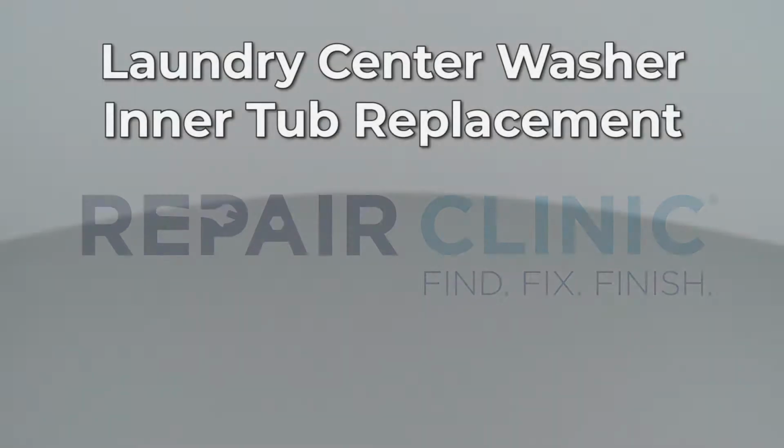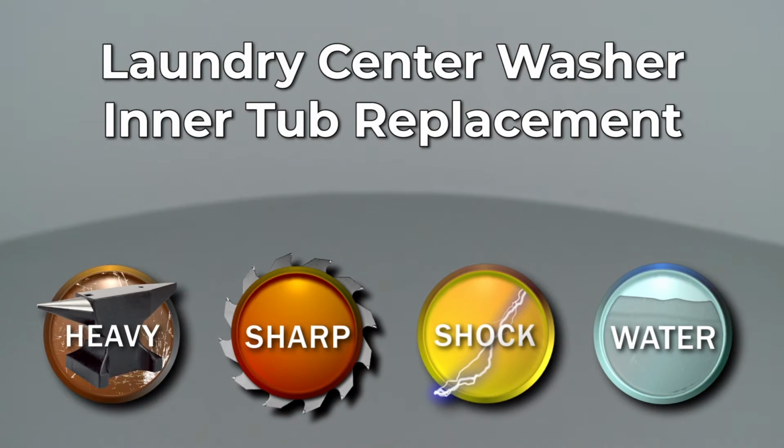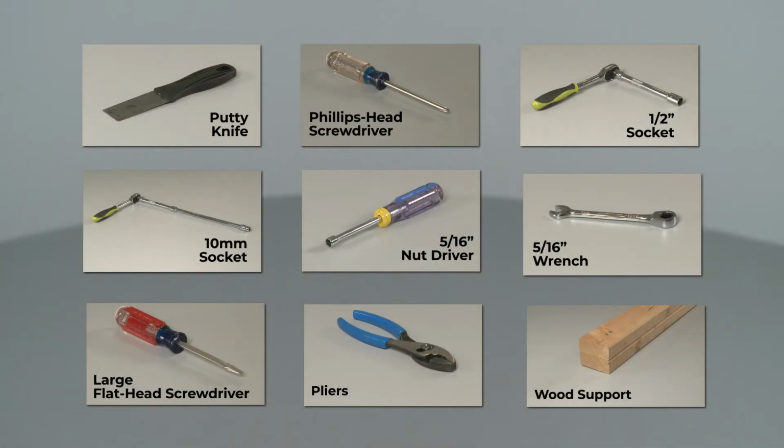Since Repair Clinic encourages you to perform this repair safely, a warning icon will appear when you should use caution. To replace the washer's inner tub in your Frigidaire laundry center, you will need a putty knife, a Phillips head screwdriver, a 1/2-inch socket, a 10mm socket, a 5/16" nut driver, a 5/16" wrench, a large flathead screwdriver, pliers, and a 2x4 wood support.